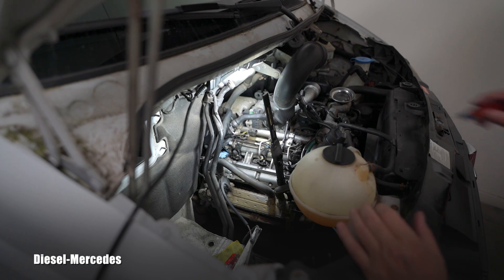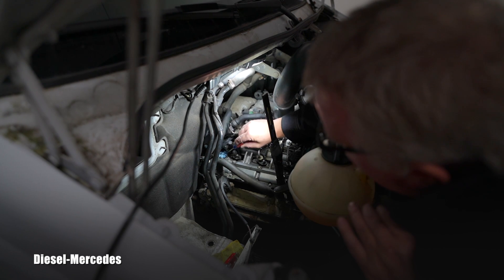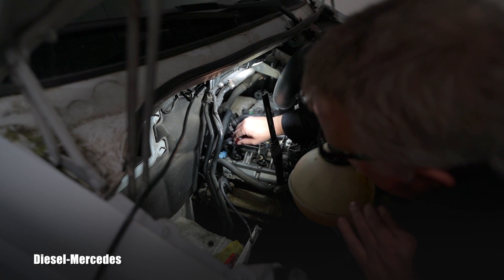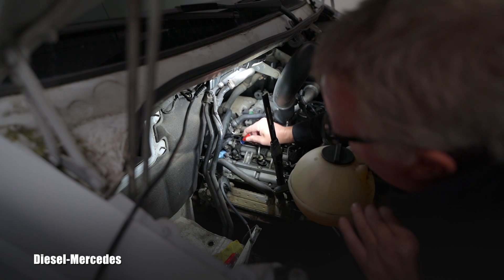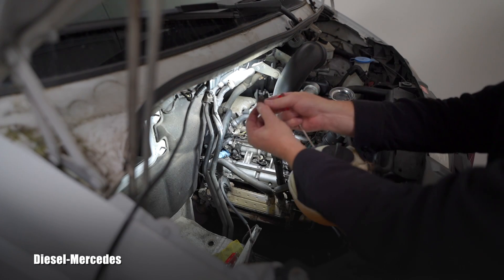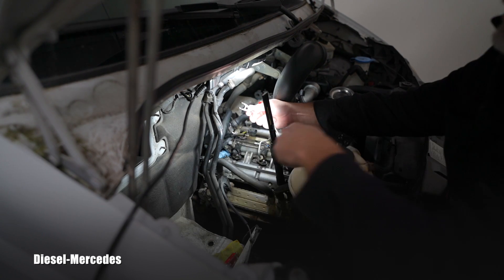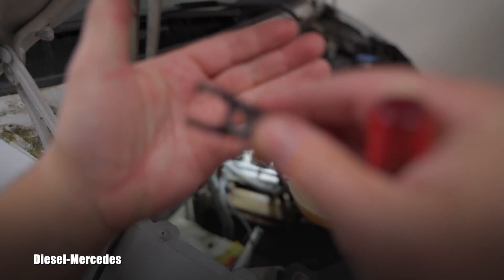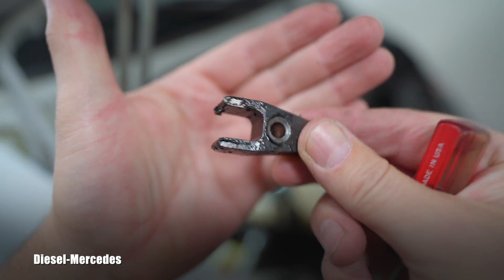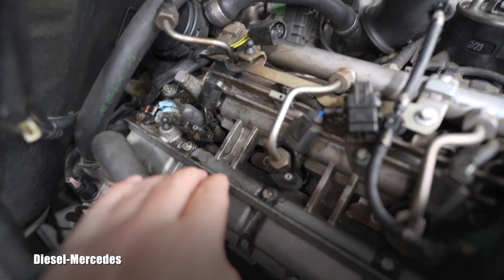I was applying Seafoam all around here. Using the mount bracket, I was turning the injector a little bit back and forth - it was difficult but it was helping. The bracket got loose, which is good because I can start spraying from the other side too. Here comes the bracket - the protrusion on top is the top, it has two sides, the flat is the bottom, and there's the hole for the hold-down bolt. A few days later, the owner is not in a rush so I was soaking it.